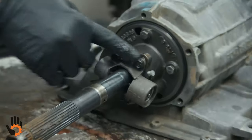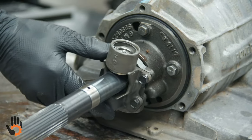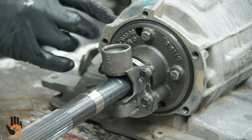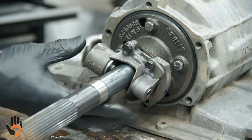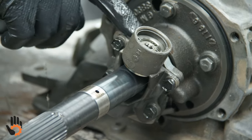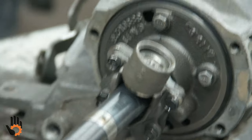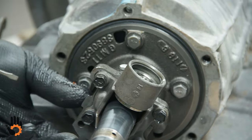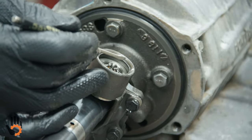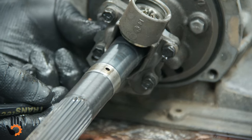And we've got to work on getting this governor off the output shaft. So a couple things we have to do here is kill the spider first, which he's, I guess, pretty dried up. He's dead. Take the four bolts off here, but we've got a lockdown screw here, or anchor screw, that we've got to loosen up. And then we've got a pin, if Robert can get a shot of that right here, that pin goes clear through the governor, through the output shaft, to the other side, to another valve, or governor valve back there.